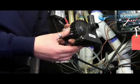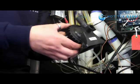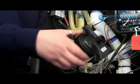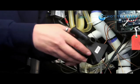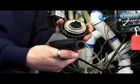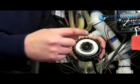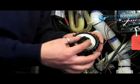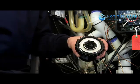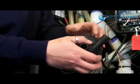Right, whilst we've got the pump out, I can show you how we disassemble it to check for scale. The new pump here that we have, we can unscrew. And the wet end just comes off like so. What you can then find is you will get a build up of calcium and even hair or any leaves or anything that may have gone through the filters gets built up in this area. Clean that off, pop it back on, screw it back together again.